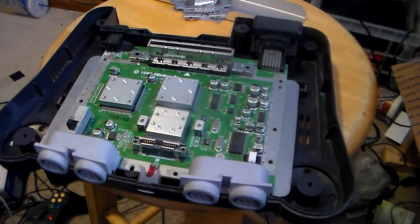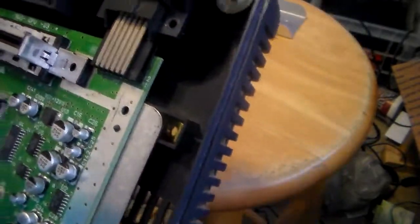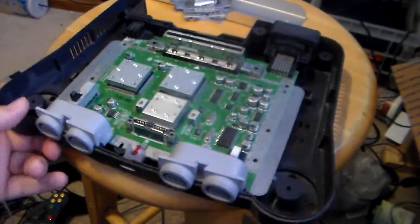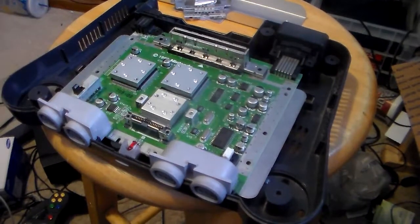If you're having problems, always check to see if the power solder points are good, if none of the cartridge slot pins are bent, and if the video slot is good. Be sure the controller ports work too. I'm going to test this out before I fully put it back together, but I'll put the heatsink on first because I don't want to overheat it — like what Alex Kermit did in his overheating-an-N64 video, which I'll link in the description.